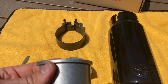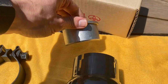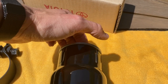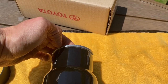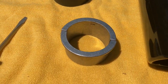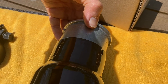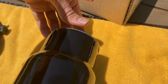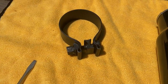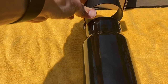You want to make sure that the lip faces on the outside. What you want to do is take these half-circle inserts and slip them on the back side of the exhaust tip, making sure the flange is facing outside. Replicate that for the second piece on the bottom — they fit together just like so. Then take the exhaust clamp, which slips over this assembly.